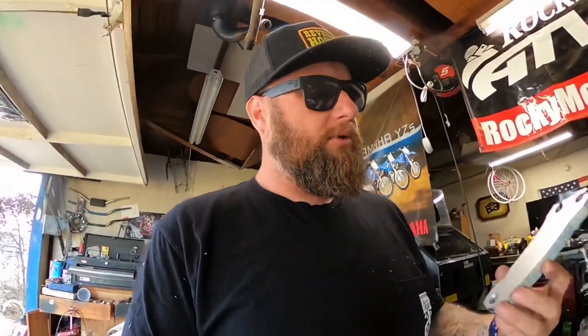So guys, today we are going to do a little different step than everyone else has done in the past. I've watched now a couple videos on Cerakoting, and everyone kind of has their own approach. The definite premise of all of these though is a part has to be immaculately clean. So what we are going to do to our fabricated love missile here, we are going to degrease in Simple Green. Then we're going to throw it in our LMS Blasting Innovations cabinet and get those all vapor honed. And then we're going to soak them in acetone for 10 to 15 minutes. Then we're going to bake them in.